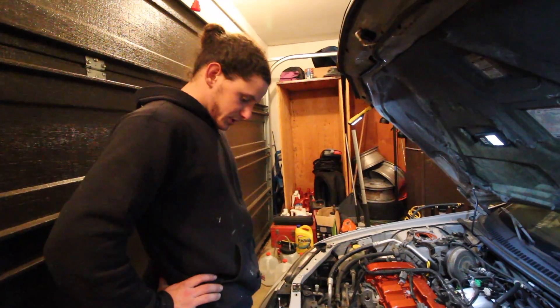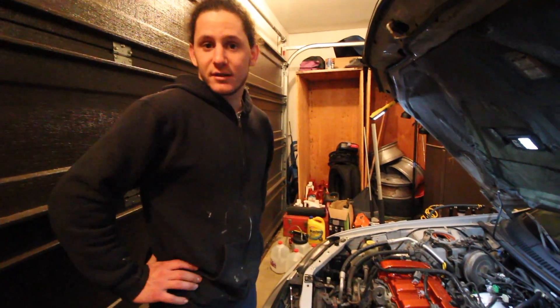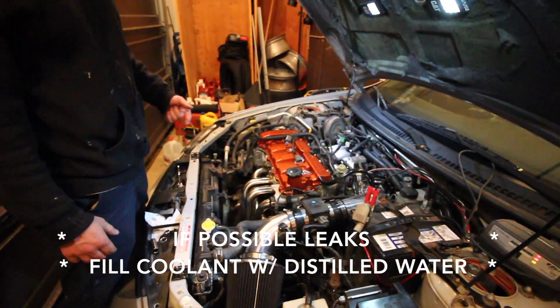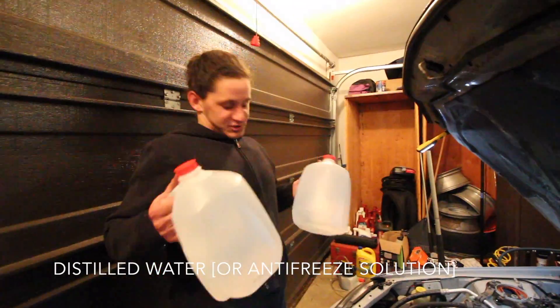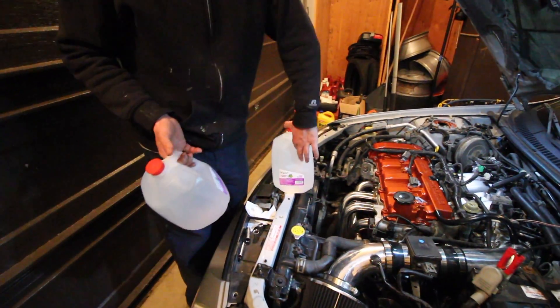The first fluid — putting water in the radiator. I don't want to put antifreeze because just in case I have a leak, I don't want antifreeze going all over the place. So I'm going to put water in and then change it to antifreeze later on. Because antifreeze doesn't dry up. Distilled water — you don't want to put regular water in there. Regular water could corrode inside your radiator and inside your engine. Distilled water won't do that.